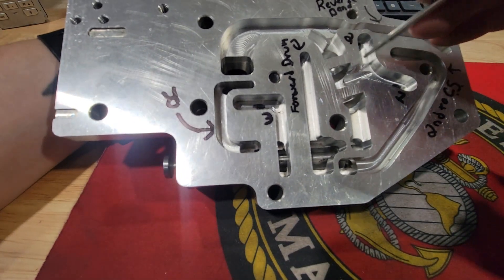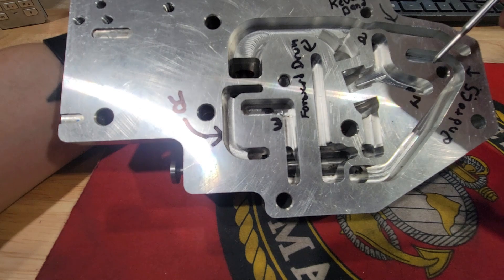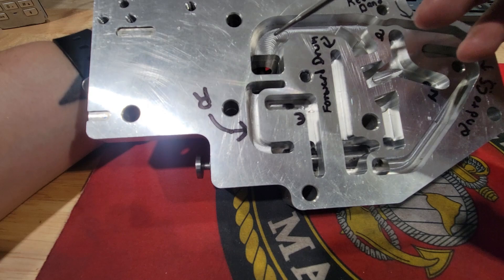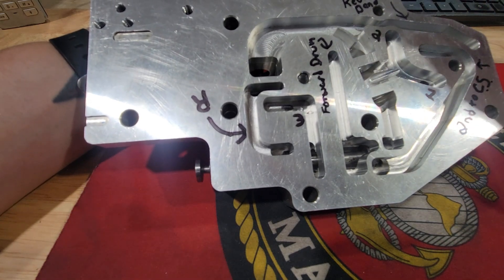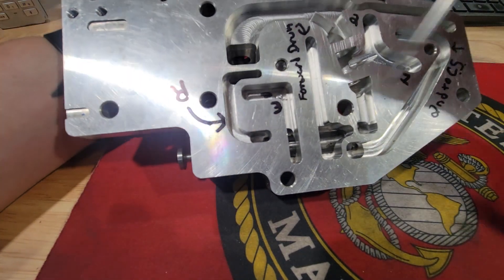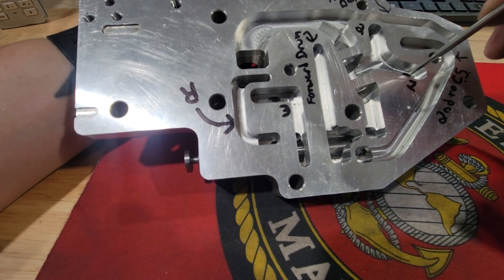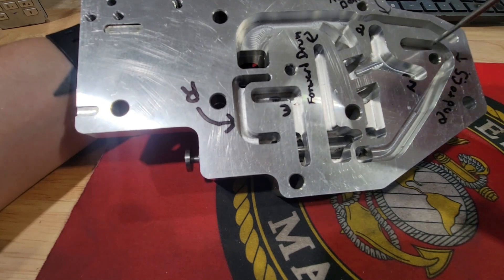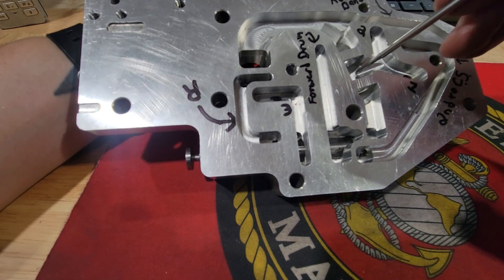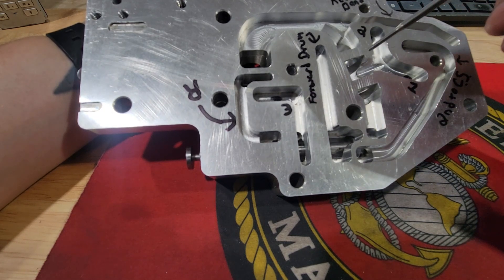That's what gives us third gear. So in first gear the direct drum is counter-rotating; second gear it completely stops; third gear it moves in the same rotation as the forward drum. This gives you a pretty good idea of how this all works and why it does what it does. This is a very basic white-label trans brake valve body — simple and basic.